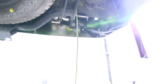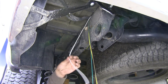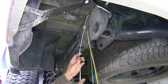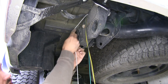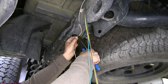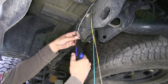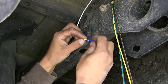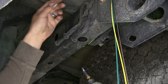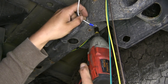Now we're going to separate all four wires as high up to the frame as we can. We're going to start with our white wire — our white wire is going to be our ground — so we're going to find a good spot to attach it. I'll route it around and come to the bottom of the frame, cut the excess wire off, and strip back the end. With the wire stripped back, we're going to take the included ring terminal, slide it over our wire, and crimp it in place. Then I'm going to take the self-tapping screw provided in our kit and a 5/16 nut driver and drill that screw directly into the frame.